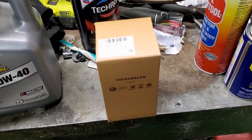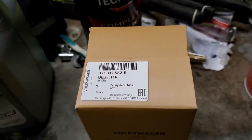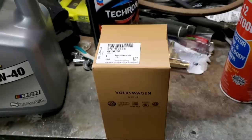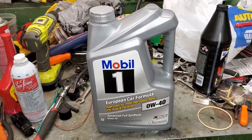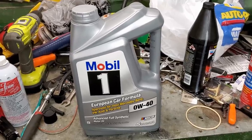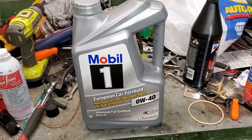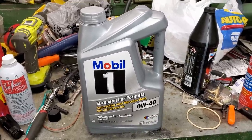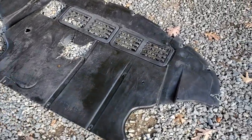Here we have an OEM oil filter, and as you can see it does say Volkswagen on it. If you're not familiar with the Bentley brand, Bentley is actually owned by the Volkswagen Auto Group. Most of the parts I've been buying are from Volkswagen and the Audi dealership - they are the same parts you get from the Bentley dealership but at the Volkswagen and Audi price. It's also important that you use the correct type of oil - this car requires 0W40 Mobil 1 Synthetic, which makes sense being a turbo car. This oil is not cheap. The cheapest place you can find it is usually Walmart at around $26-$27. This car requires 13 quarts - three bottles - so that's $75-$80 right there with tax. I was lucky enough to get these bottles for $20 plus tax each. Walmart hands down is the cheapest place to buy oil. So the first step is to remove this giant splash shield from underneath the car.